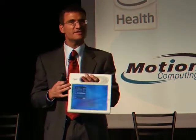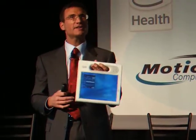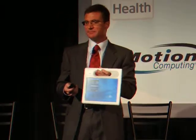To address disinfectability, we've chosen a set of materials. An example is the resin that makes the chassis, which is resistant to chemicals, so you can disinfect it repeatedly with all the typical chemical agents used in a healthcare institution. The chassis is semi-sealed, with minimal grooves and minimal ports to eliminate places for bacteria to collect. It even has liquid-resistant microphones to try to keep bacteria out of the device. So you can clean it in about 5 seconds with a disinfectant wipe, much like the time it would take to wash your hands. And that was the objective for the product.